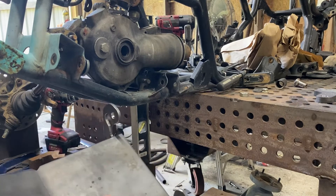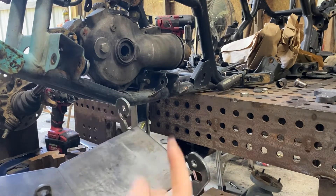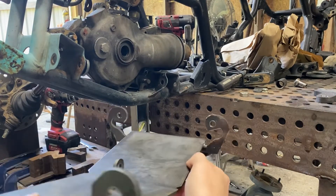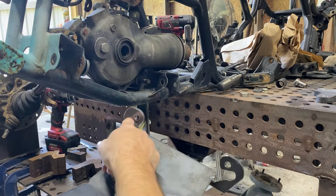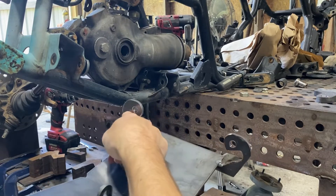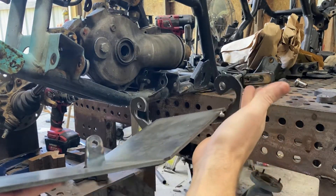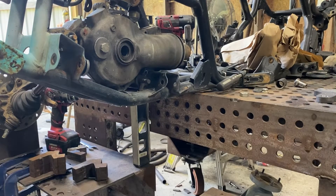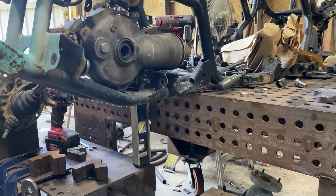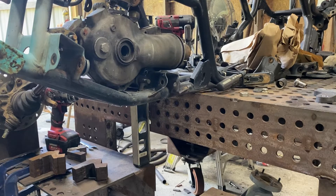What you'll want to do — this is basically what you'll have. These little back hooks go to the back, this side goes to the front. This kind of has to go in at a little bit of an angle, kind of almost at a 45. You'll hook this back side on the little tab that goes down your frame, hook that on that side, pull it forward as much as you can, push this side up, and then twist it into place. It's not near as easy as the old design install, but it's really not that bad — just a little tight right there.